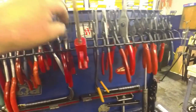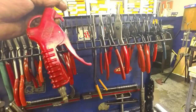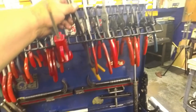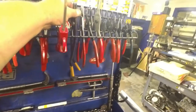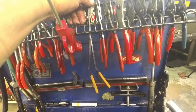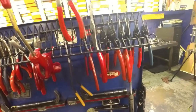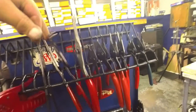Various wire cutters and things — this is made by Vacula but it's a Mac brand. This one here I got from Transtar back in the day — it was made specifically for doing the snap rings on the 604s on the pinion shaft. Different tips for different things.